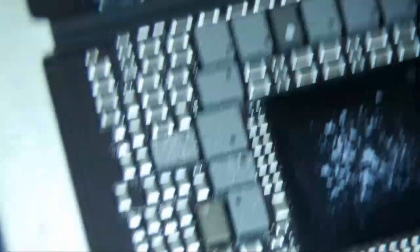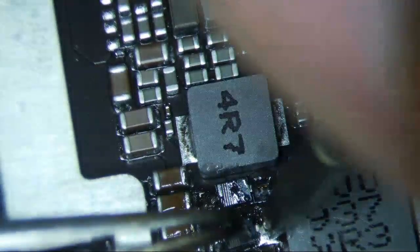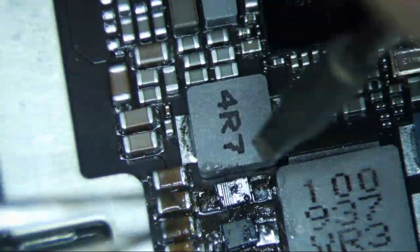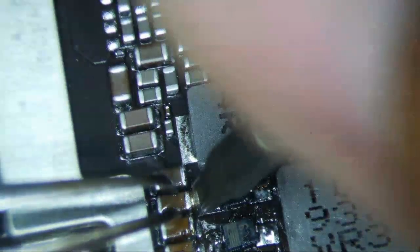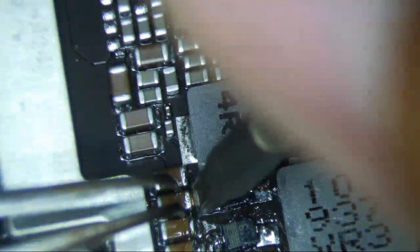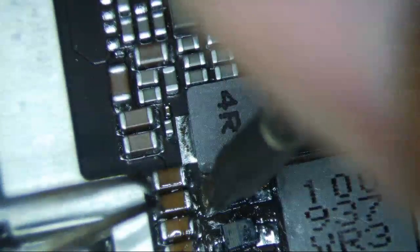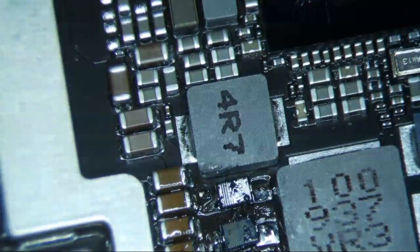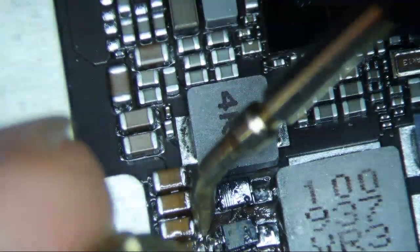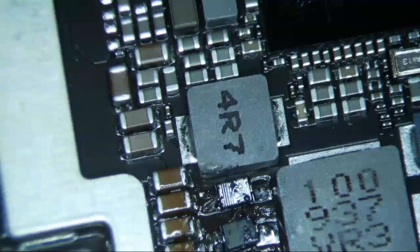Okay, that's good. We'll turn the iPad around. Make sure you isolate the battery before you do anything, otherwise there's going to be voltage going across it and you're going to cause some other issues. It looks like that's actually still bridged, so that's not good — I can fix that. I think they're probably the same traces — they're supposed to be touching anyway, so it's not a big deal if they're bridged, but you never really want it bridged.